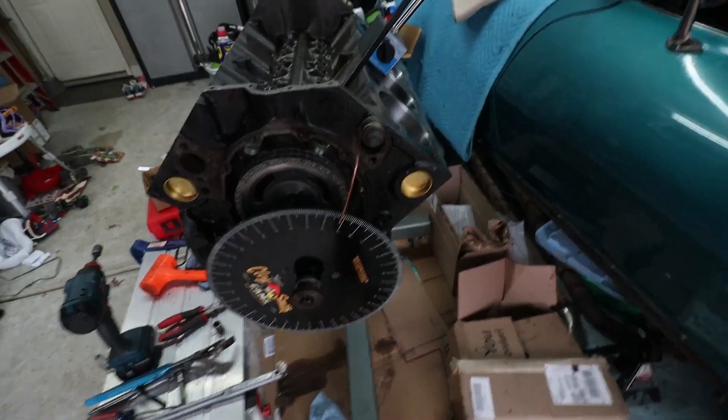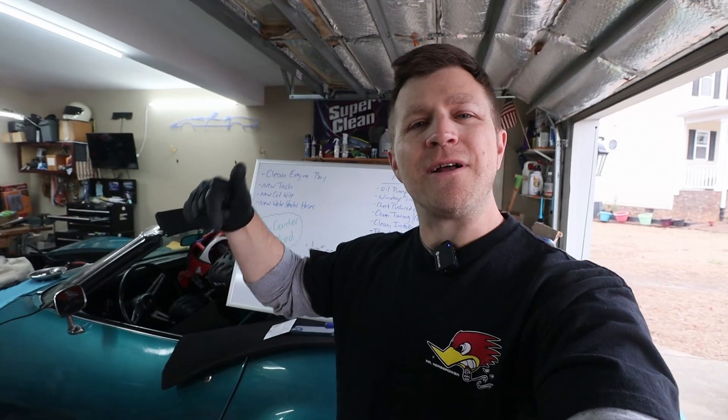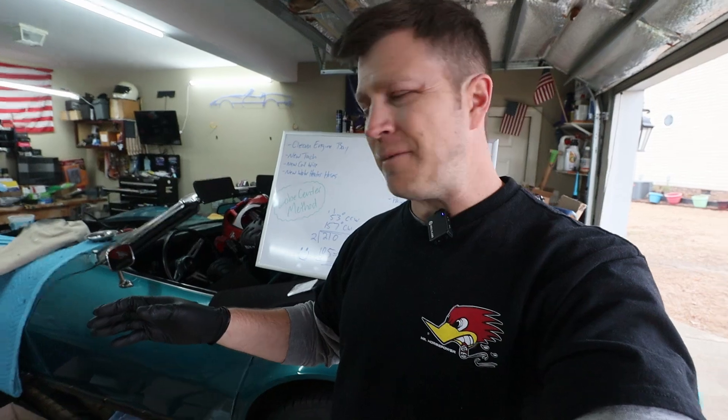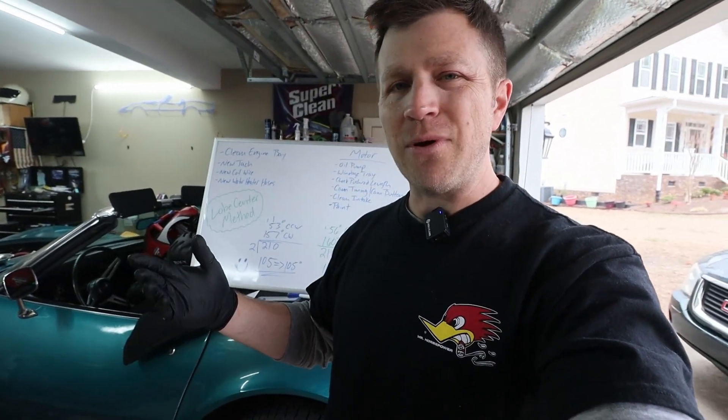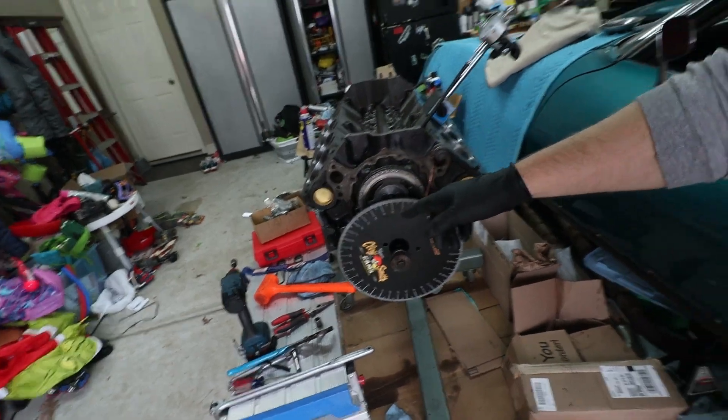Again, I will have a link to the Claysmith Cams YouTube tutorial on how to do this intake centerline method to degree your cam. I've got to say that was — with a couple of hiccups getting the dial gauge set up and the crankshaft sprocket pulled off and put back on — a relatively straightforward and easy process. Go check out their video in the link down in the description below if you need to degree your cam. We are degreed at 105°, right where the cam card says it's supposed to be — all is good with my custom Claysmith Cams camshaft in my small block 350.